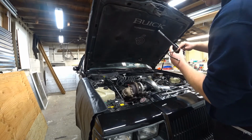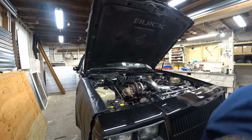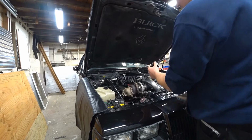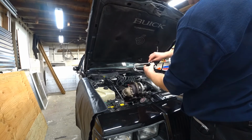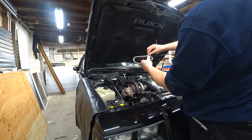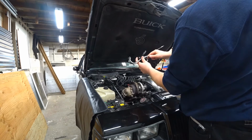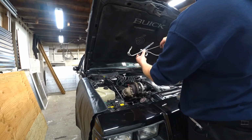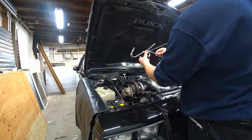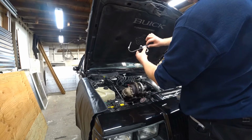And I'm going to stick this tool in here, stick the tube in the tool, find the pen cap I dropped. Sharpies are a hot commodity around here. And then hold the tube here and just think about which direction I need to bend this guy. Put my mark on the 0, and I need to rotate this guy around because I'm trying to bend him the other way. And if I hold this tube like that, then I suppose I can rotate this one. And give it a go.